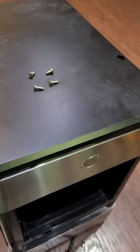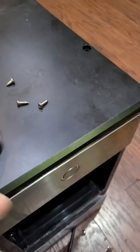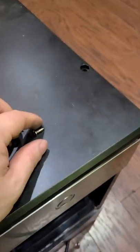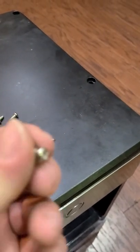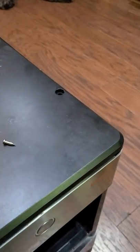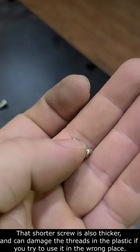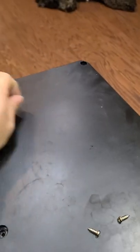I've already done the repair — I'm kind of doing the video backwards — but there are different screws. First you take out the little rubber pieces that cover the screws; just take a toothpick and pop them out. These front screws go into plastic and use a smaller head, longer screw. On the back, it goes into metal and uses about the same size head but a shorter screw, and both of those go in the back corners.